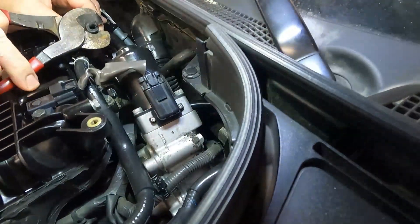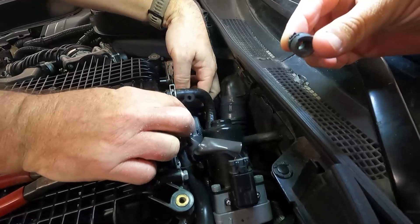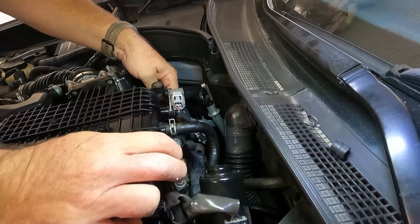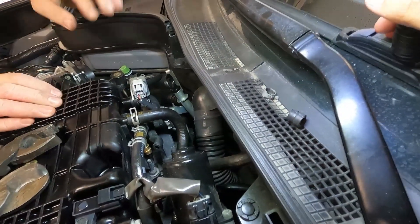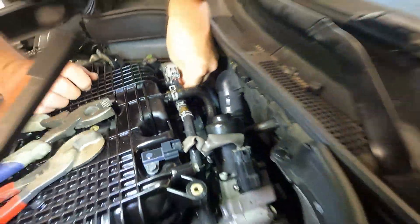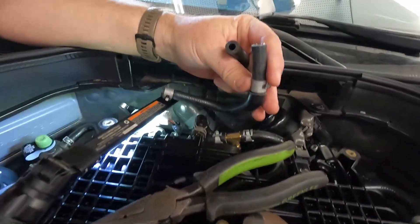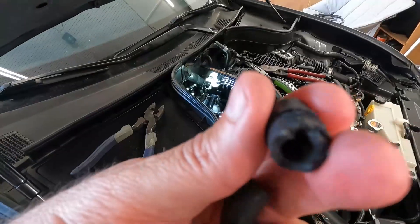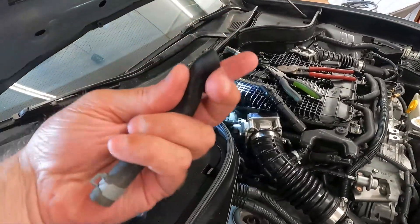There we go — there's the broken piece. Pretty easy. And where does it attach to? It goes over and ties into right behind my intake. He actually moved the hoses around, and when he did that it got too tight. It looks like there's not quite enough room to cut and stretch, so we might need to splice in another hose. Just not quite long enough to stretch, but it looks like we've got another spare that we're going to try to cut and splice into place. This hose doesn't feel real brittle, but he probably pulled on it when he had the throttle bodies off and didn't realize it — it cracked it and broke it.